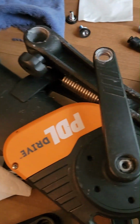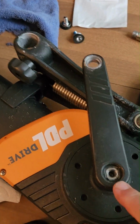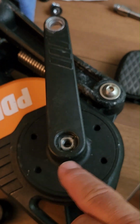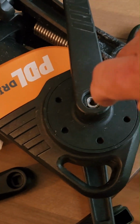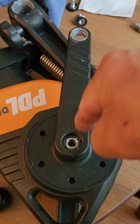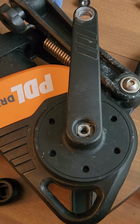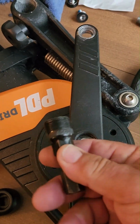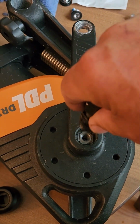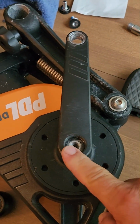All right, so what we're going to do is put in this gear puller. This is called a tapered square. So you've got a straight square, not a diamond. A diamond is turned in a diamond shape in the hole. This is a square, both on a taper. It's an older style bike crank design. You put one of these screws in, screwing it into these threads right here, and we'll get that tight. Then we'll take this other one, and it screws until it pops it up and pulls it out. We'll do that on both sides.